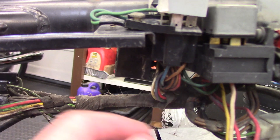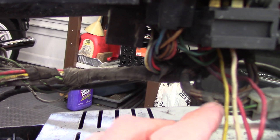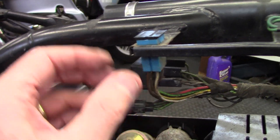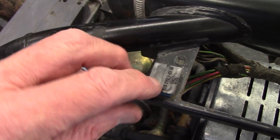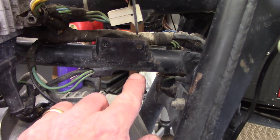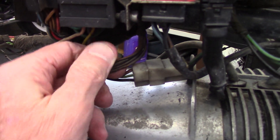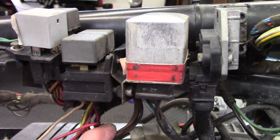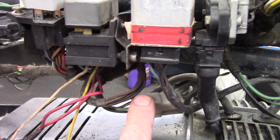The starter and headlight relay wires come into their own plug at the bottom and come off little short arms out of the main wiring harness. There's one other special plug here that has a number of different wires — headlight wires and power wires — and it takes a special connector to a wiring harness which I don't have, but I assume it was for powering various auxiliary components. Right here is where the coil mounted, but this bike didn't have a coil on it when I got it — these are the wires that would go to the coil. There's also a big bundle of brown ground wires that attach to the back mounting bolt for the bracket of the voltage regulator, which is really the central ground for a lot of the circuits on the bike, so you want to make sure that's a nice tight fit so you won't end up with any flaky ground.